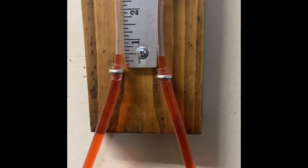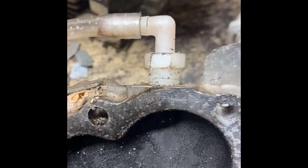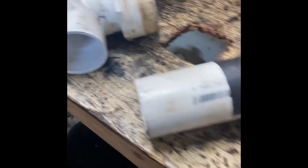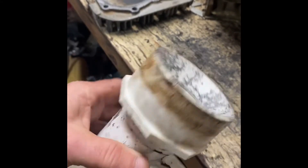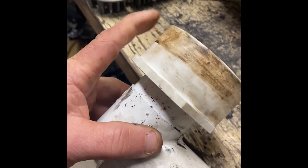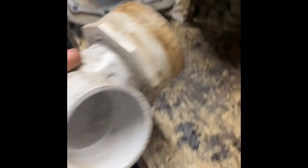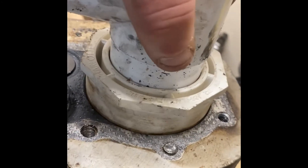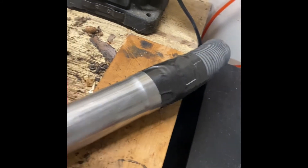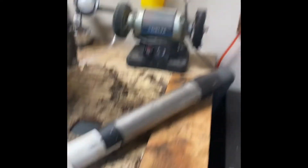The tube is open at one end with a loop, and I put enough water in it to start pretty close to zero. The other end threads into a fitting in the spark plug hole. For vacuum, it's just a little shop vac that's been laying around — got an adapter on it, a piece of PVC pipe. I took a reducer bushing and cut a small taper on it. Depending on your engine's bore size, you'll need to figure out what to use. It's just got a little 90-degree elbow so it goes in the bottom of the cylinder and fits tight. It's very important to not have any air leaks or it will screw your numbers up.